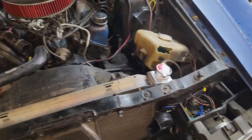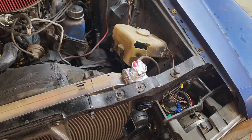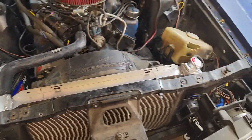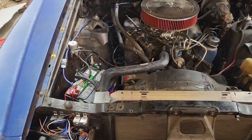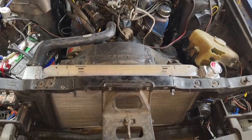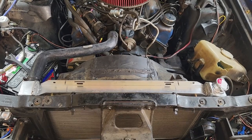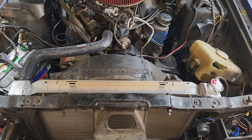I burped it as I showed earlier. It might need to be burped a little bit more. I got it up to a little over 200 degrees with a 180 thermostat in it, and ran it for a good while in the garage. Then I took it for a drive and it stays right at 180 when you're moving. There it is — a nice aluminum radiator, $160 off Amazon. Decent fit. Obviously you don't use the stock mounts for it, but still, got to love it.